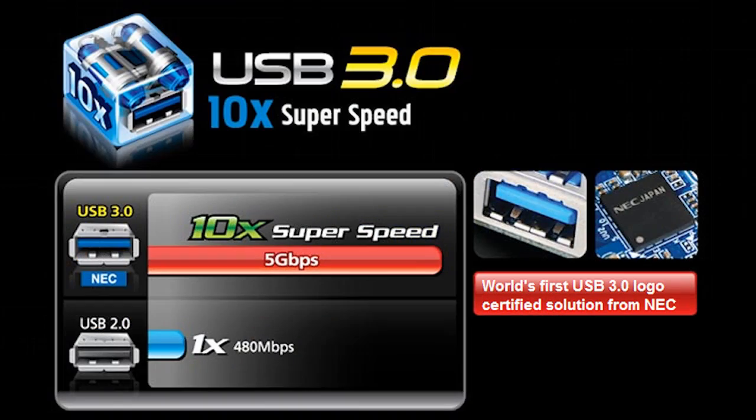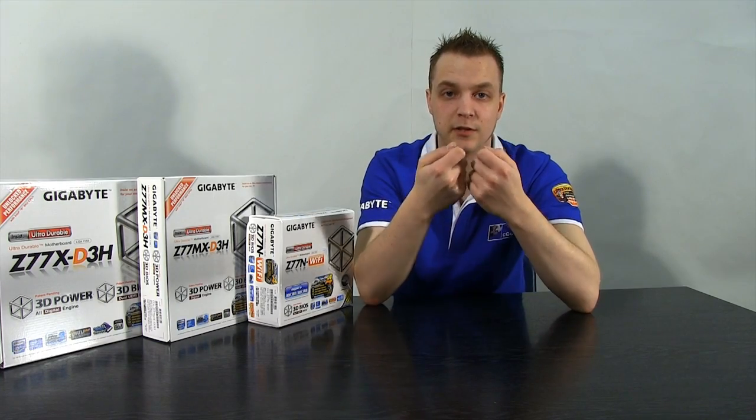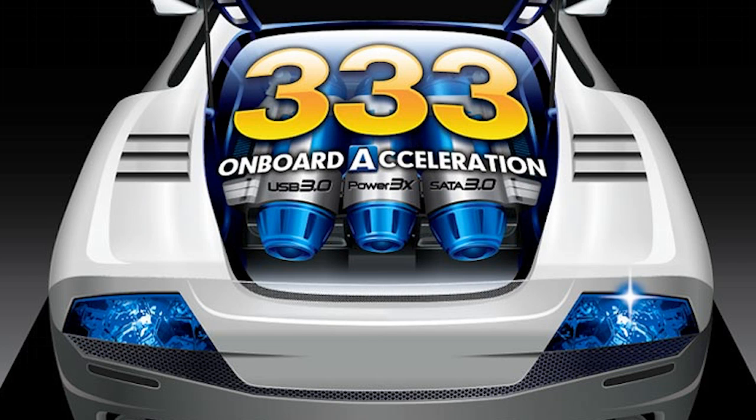USB 3 is the newer faster universal serial bus technology. USB Power x3 means it puts out more power than a standard USB port — so if you've ever had an external hard drive that won't spin up properly or needs one of those leads with two USB ports for additional power, you shouldn't need that here because you're getting three times more power. The onboard SATA 3 at 6 gigabit per second covers all the bases for connectivity with external and internal drives.